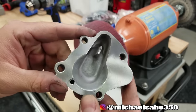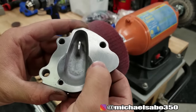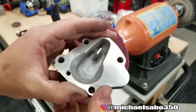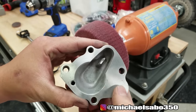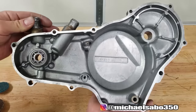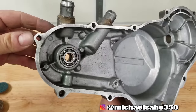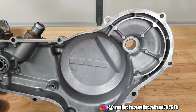That one was a little bit tough. This probably isn't quite as abrasive as the cookie wheel. If you look at this aluminum, there's actually some damage to it — this is an older piece, came off in 1987, and I believe this is the original cover. But it cleaned up fine and this will work; it will not leak. We're also gonna surface this stuff, so we'll probably be able to get all those imperfections out. There's a little spot that's scored, most likely from another time this cover was removed, but the way it is right now with a fresh gasket on here it shouldn't have any leaks.